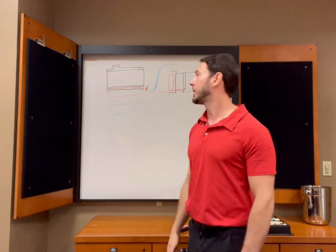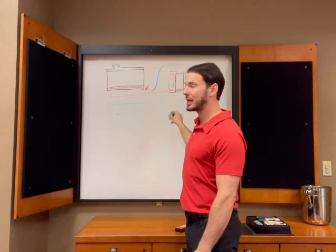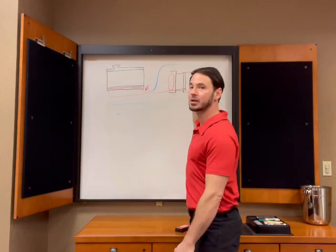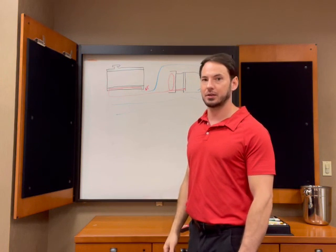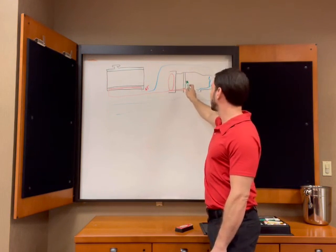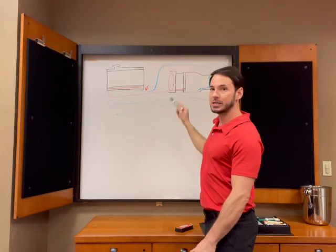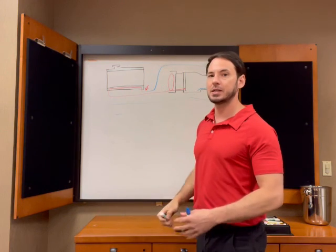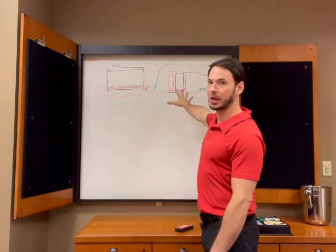It's not necessary. That cold fluid is actually worse. Like I said, none of the stuff in here is optimized for fluid below about 170, right? And as a matter of fact, I'll talk in a later video about what the actual problem with the transmission is, but the TCU is the idiot in the room, and the TCU is most of the problem why we have transmission problems.